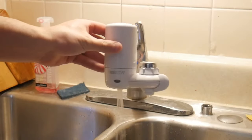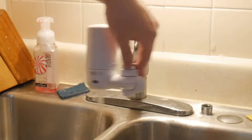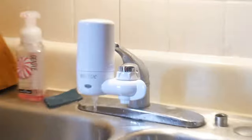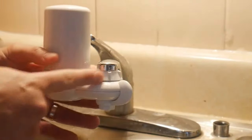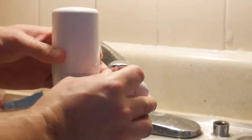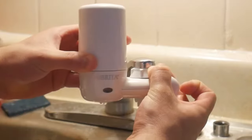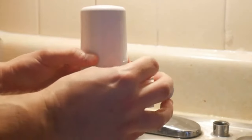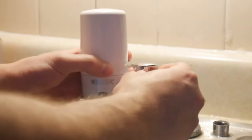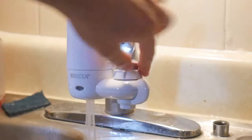So far no leakage. Now it's going through the filter and it's not leaking. Let me zoom in and show you exactly what I mean. When you're tightening it, twist it on as much as you can and then have it facing like this. Put your two fingers like this and hold it, and twist the whole machine and everything at the same time. Then take your two fingers again, twist the little twisty, and hold it, pulling back the Brita machine so that the washer here is not moving — just the machine. Then move both the thread part and the machine until it is solid until you can't do that anymore. Move the machine back to where you want it and you're good to go — it shouldn't leak.